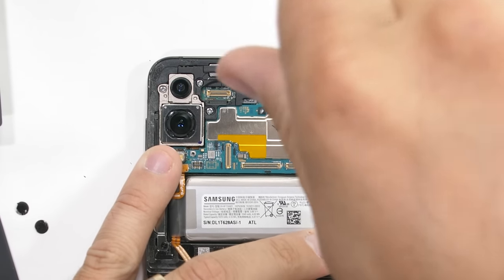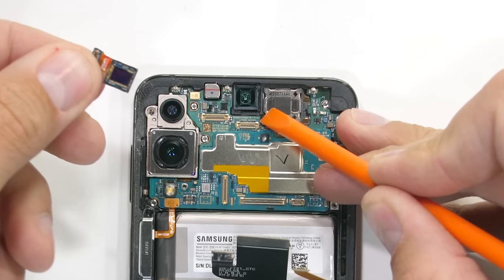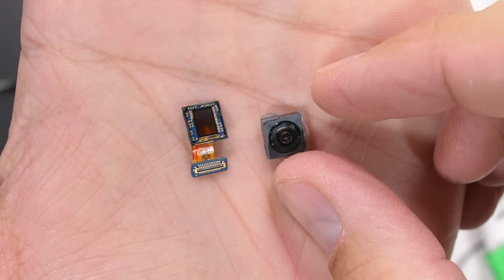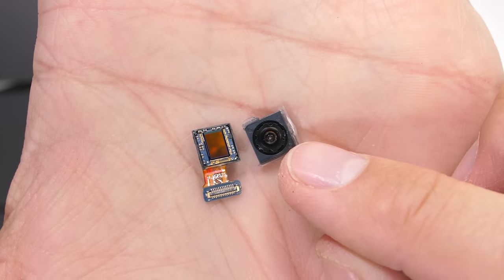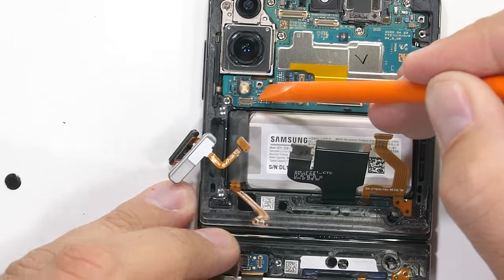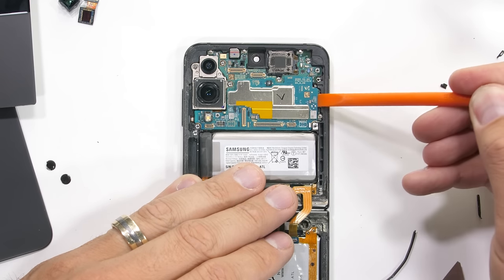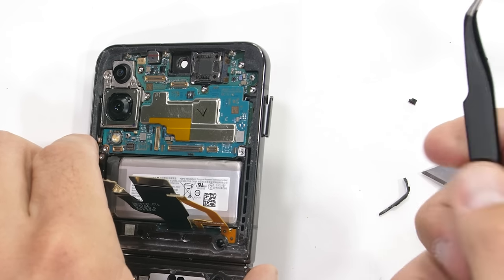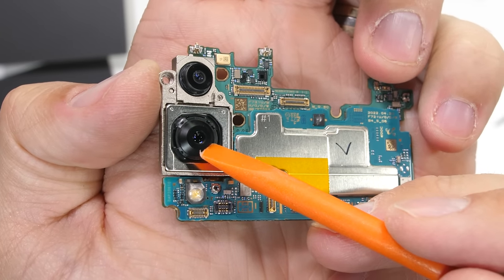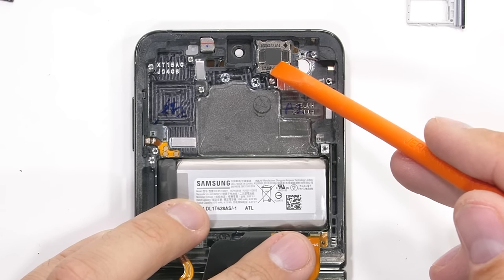The top plastics have another six screws holding them in place — nothing special, just plastic. We do however see our 10-megapixel selfie camera's sensor, since the unit is glued in place and now it's destroyed. Normally these cameras aren't glued in so tight, but there's that little Easter egg — there is no OIS. Coming back down to the phone, we see our power button has its own silver bracket and the same gasket-style construction as the power and fingerprint scanner on the Fold 4. Samsung is obviously sharing tech between the two. The motherboard can be removed at this point if you remember to take out the SIM card tray. Then we have the 12-megapixel ultra-wide camera with no OIS, and the 12-megapixel normal camera which does have optical image stabilization. There is no thermal paste or foam on the back of the board — just large graphite pads placed beneath the circuits.